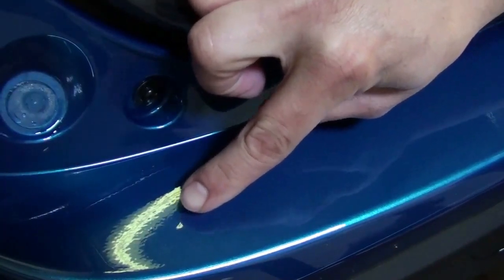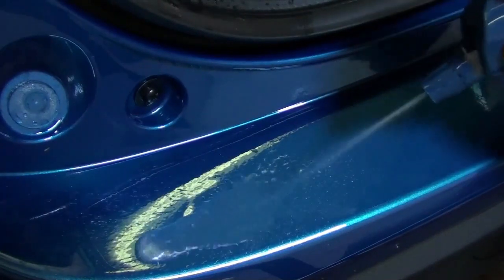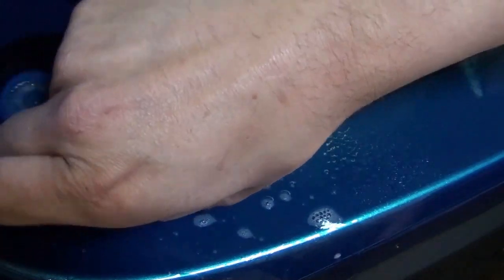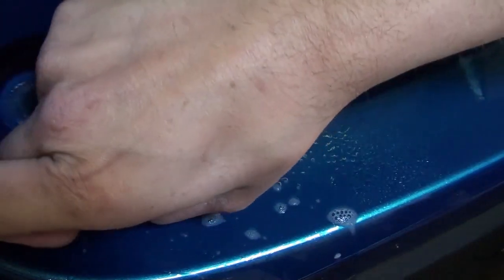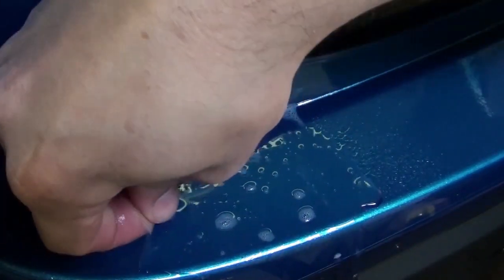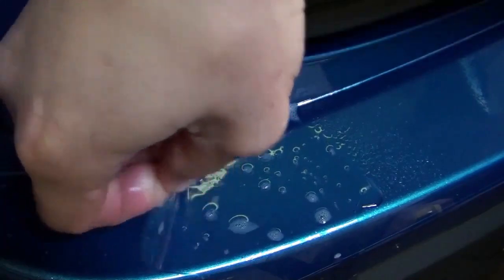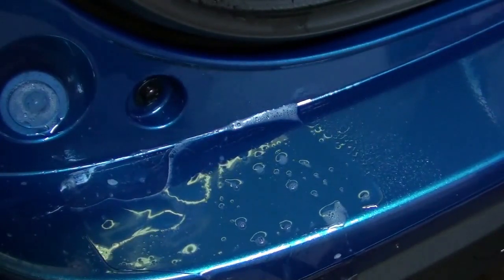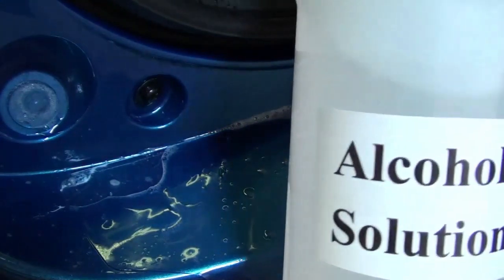If there are air bubbles under the film, they can easily be removed. Spray the top of the film with the soap solution. Next, lift the film edge until you reach the bubble. It is also a good idea to let the material relax for a moment before squeegeeing out the air bubble. This allows stretched film to return to its original size and shape and greatly reduces the chance for new bubbles or creases.